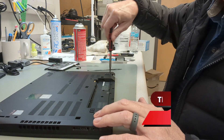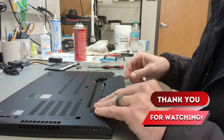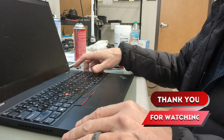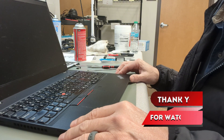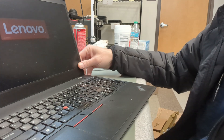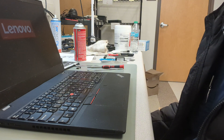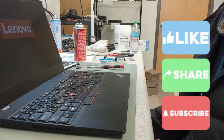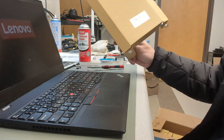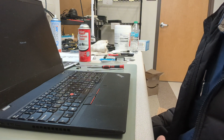These are dual battery laptops and normally when I replace one battery I'll go ahead and replace both. For this one I'm not replacing the external since I already replaced it before this video. Opening it back up and powering it on — we've got the Lenovo screen and we're good to go. This will fix your laptop if you have a battery error showing up. I'll put the link to the CRC QD cleaner and the battery in the description with my Amazon affiliate link. Thanks a lot, have a good day, God bless you.